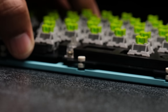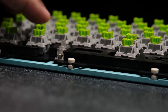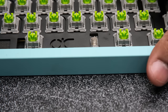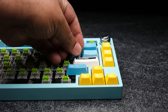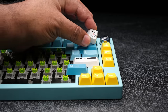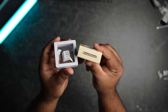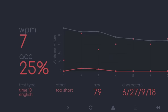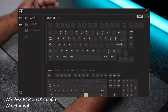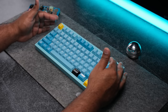Now that you're all connected, lay down the assembly into the bottom case. The rubber gaskets will align with the gasket grooves in the bottom case. All you have to do is install the top case, which has only five internal screws. Install the rotary knob with the provided screw. Install your keycaps — find a nice artisan to complement the color or season. If you want to remap the keys, you're going to need to use the QK configurator for wireless PCBs, which is pretty straightforward to use. The wired-only PCBs will still be supported by VIA.